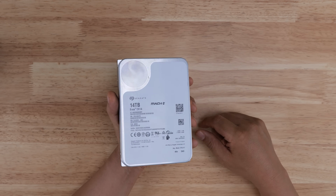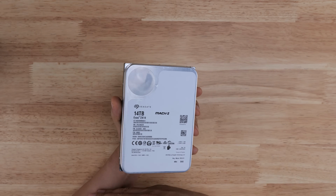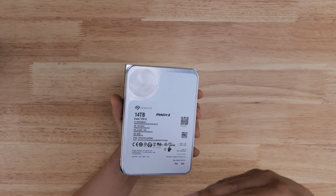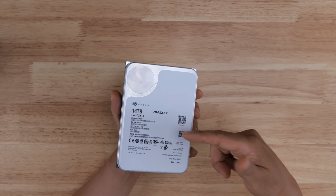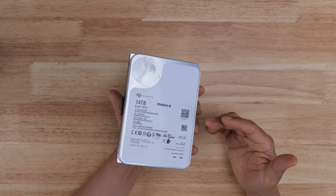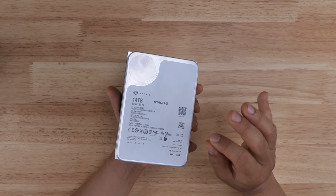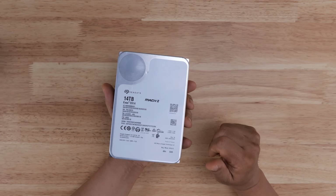If your data only resides on one of the two sets of platters, your IOPS is no better than a single drive. Similarly, for the second point about sequential bandwidth, your data needs to be spread across the two sets of platters in order to benefit from the higher throughput of reading or writing data to or from both sides of this drive. So to reap the rewards of this technology, it's important to organize your data in a very specific way.